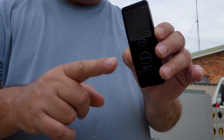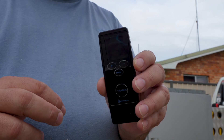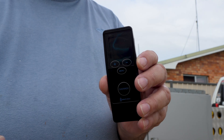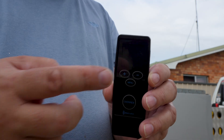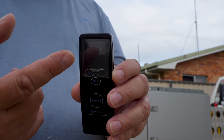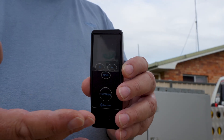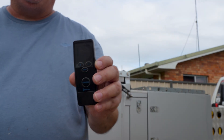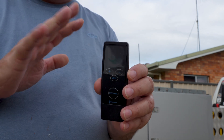The remote also has adjustments. If you click on menu, you can set it for up to five settings. You can have a setting for driving on the highway with an empty trailer, a setting for driving on the highway with a full trailer where you'll probably want a higher brake response. All you've got to do is press it twice and go to setting number two. You can adjust the naming — highway heavy, highway low, 4WD low, 4WD heavy, and so on. You've got one spare for whatever setting you want. That's a unique feature — you don't get that with a lot of the others. It's a set and forget as well.